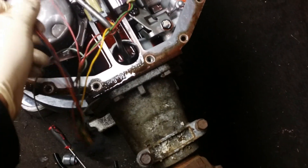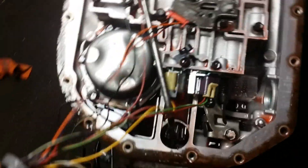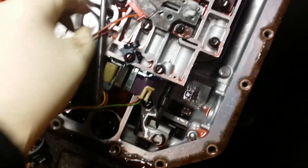You're going to see — and if I believe correctly, this is pin E. Depending on what transmission you're using, the wiring may be different. This transmission is from a 94 one-ton. So first and foremost, you're going to have switched 12-volt to your red wire here. And then here are just two solenoids — you have A and B.